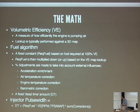We also add dead time — the amount of time it takes to open a fuel injector minus the time it takes to close it. During those periods, the injector is spraying a reduced amount of fuel and you need to take that into account. So in the end, the pulse width equals dead time plus your required fuel constant times a VE lookup — which is RPM and either TPS or MAP depending on what load method you're using — times the sum of corrections.